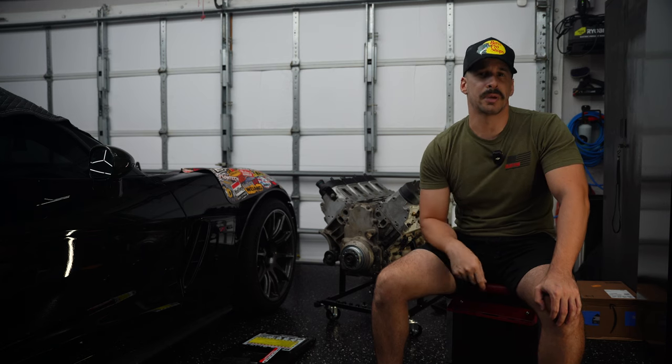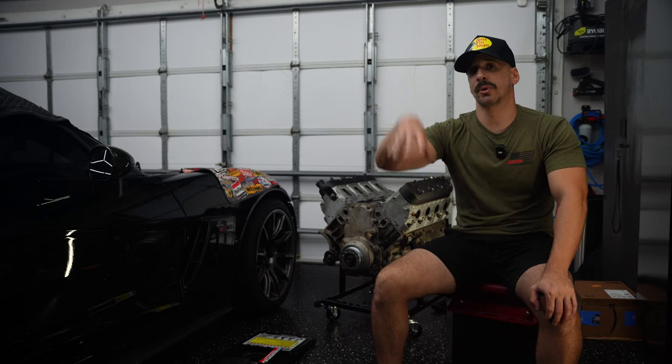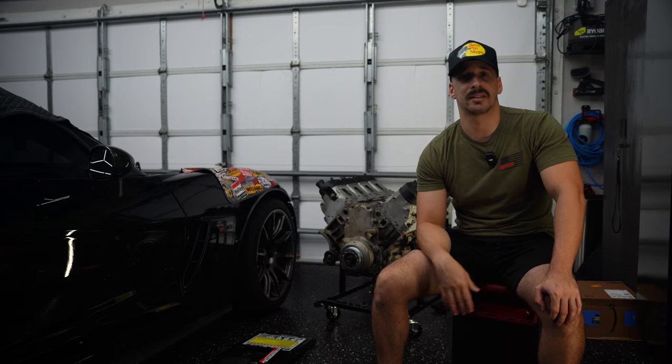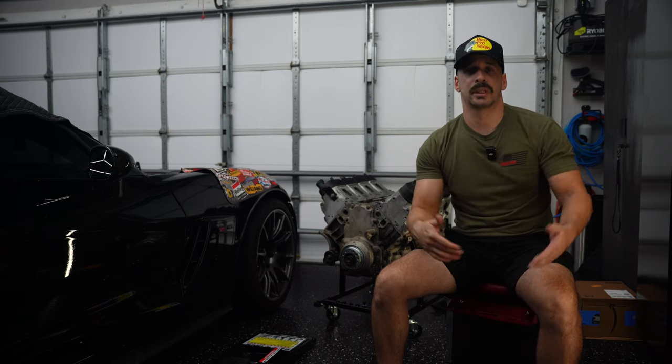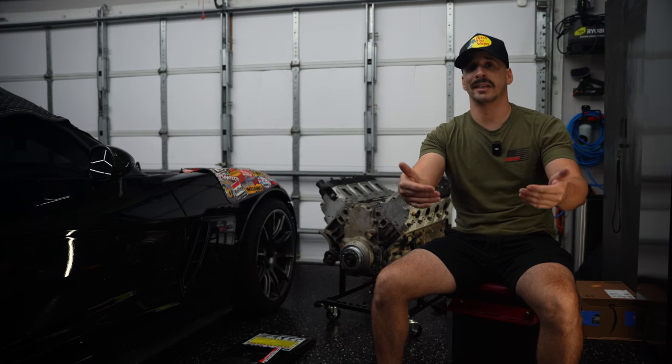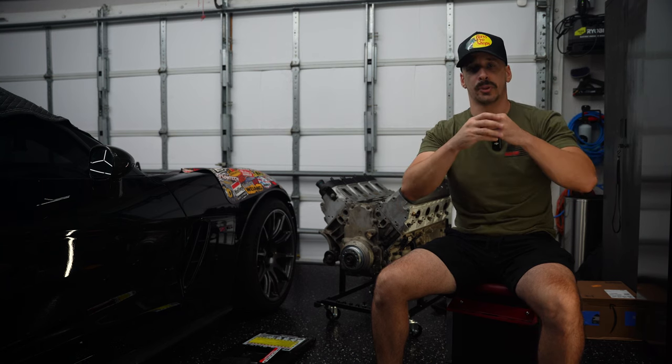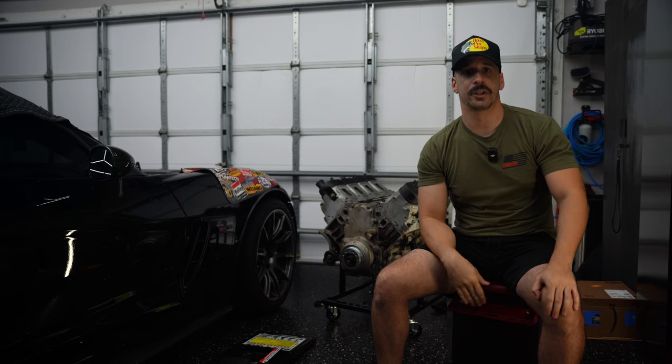There's basically two key methods that I saw everyone doing that were pulling the motor from the top. Method number one, which is the most common method, was disconnecting the steering rack, to allow yourself the room and space you're going to need to pull the motor forward in its position and then lift up so it can disconnect itself from the input shaft of the torque tube.